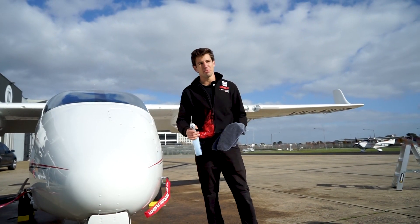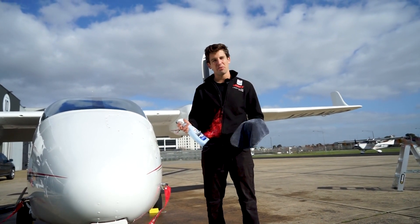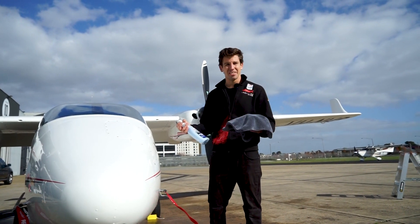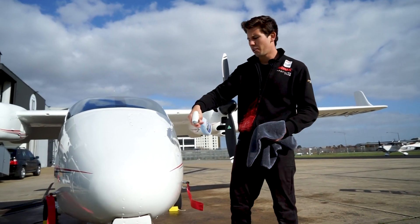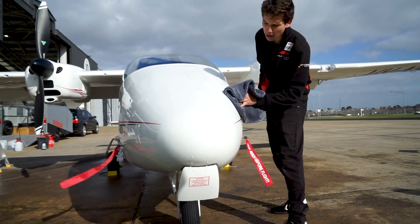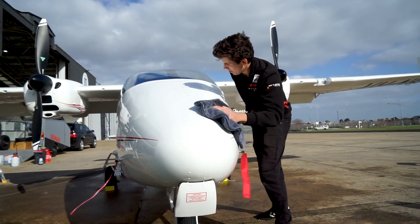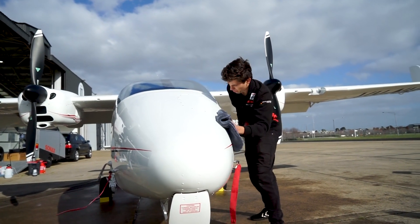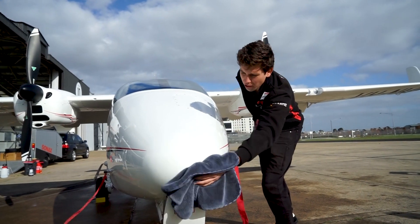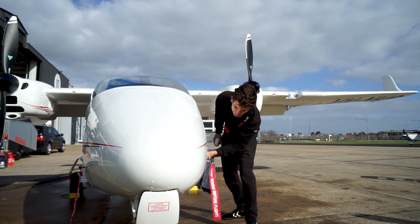For the very final touches, we're using Brilliant Shine Detail – it's a polymer-type sealant that leaves paint protection for the next three or so months on your airplane. It also makes it much easier to clean the next time. We give it a good spray on the surface and then use our Plushius microfiber to spread it until we have a nice streak-free finish. It gives an extra layer of protection that can minimize paint oxidation and corrosion in certain spots. It's also silicon-free.